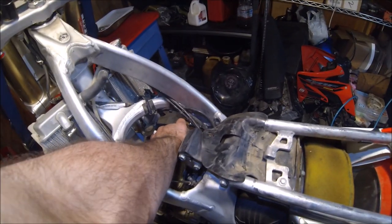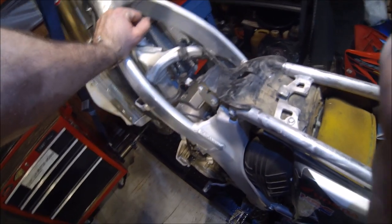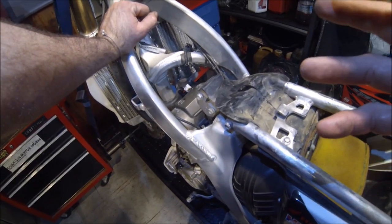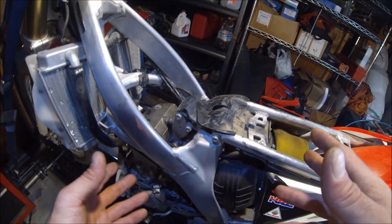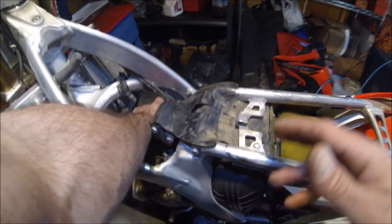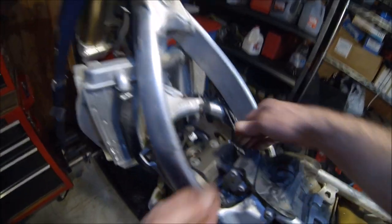Okay, and another thing too, when you're doing these procedures, valve adjustment, you gotta make sure your engine's at room temperature. I've seen other service manuals from Suzuki say 93 degrees Fahrenheit is the correct temperature to do the valve adjustment on their motorcycles. So I'm assuming somewhere between room temperature and 93 degrees Fahrenheit would be acceptable. If you just got done firing up your engine and riding it around and you're trying to do a valve adjustment, you're gonna have incorrect readings because everything's gonna be hot and expanded, and you're gonna pretty much waste your time and possibly damage your engine. So we want to make sure everything's nice and cool. Our engine here is right around room temperature. The cylinder valve cover here is nice and cool to the touch. So we're going to go ahead and get to it.